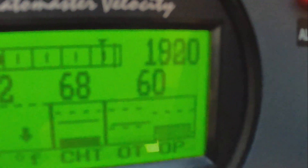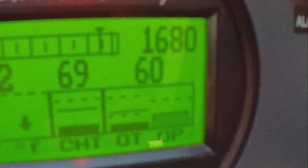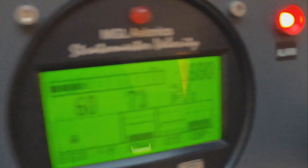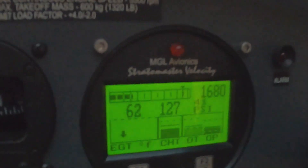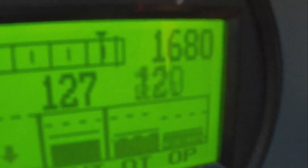As you can see, I've already started the airplane. At time mark 6:02 p.m. I had a 60 degree oil temperature. I sat here and let it run until we got it to 120 degrees. And here we are at 120 degrees — the time stamp is 6:11. So, 9 minutes to 120 degrees.